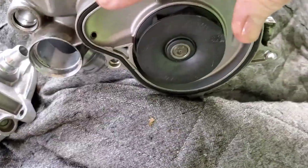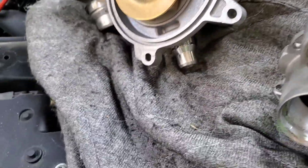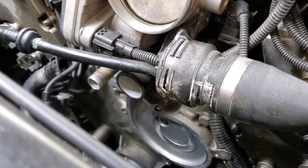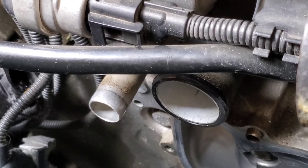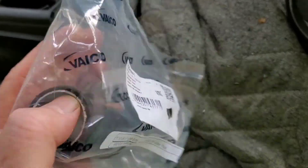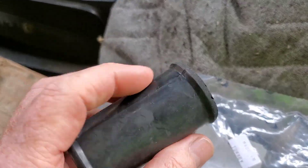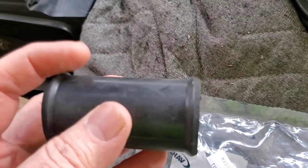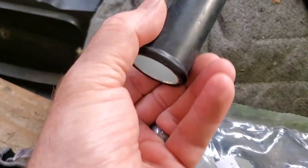Okay, so I've got a new rubber gasket here, so I'm going to put the new rubber gasket and the new one in. And then I still have to pull out that pipe down there, that rubber hose — it's the larger one on the right there with the white interior. So I'm going to pull that out and put in a new one. This is my nice new one. And before I try to put it in, I'm going to get a little bit of my fresh coolant and run it around the end here. That way it should lubricate it a little bit without contaminating anything.